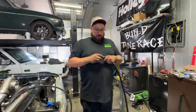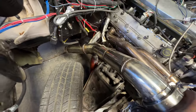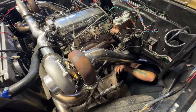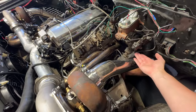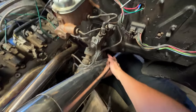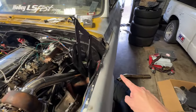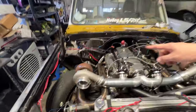On the other side I added the flange and tacked it on — check this out, it lines up super well with where the O2 sensor is, which is fantastic. Over here I took a 45 for a straight shot. We'll have to move the brake lines up or wrap them with heat, probably both. This body line actually has a little mount right there so we can come over, hold it there, take the 45, shoot it out, and put a straight section on.